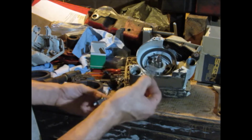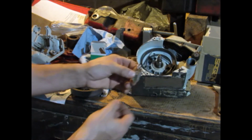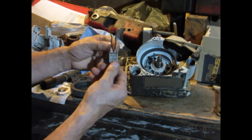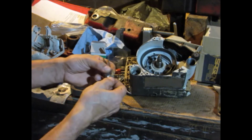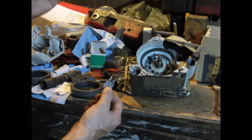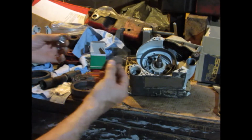It's a SIG 1 ignition module. I was using these Nova 2s, and I think what was happening was I was using hot glue to glue them onto the saw. I put them where the heat from the crankcase or cylinder wouldn't affect them, but I think the hot glue was messing them up, and they're just not tolerant to heat. So I bought this SIG 1 and put it on the last one, and it works great. The ignition works great now on that, and it was one of these that I thought was failed, so I'm going to try another one of these, and I'm not going to buy these.